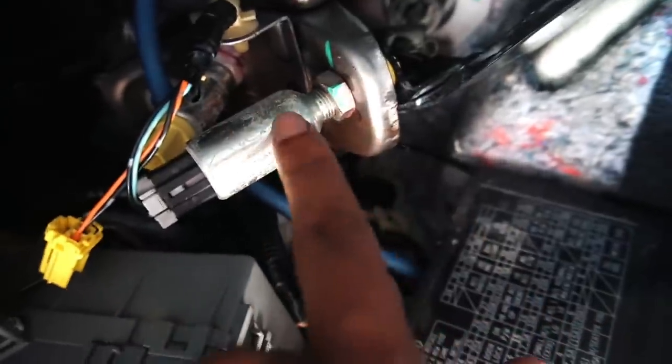Now we're going to adjust it. To adjust the pedal is mad simple. You need a 17 millimeter wrench. This is 11/16 in standard, but same stuff. It's gonna be hard to see, but basically you want to make this nut loose, counterclockwise. I think it's the one on the back. No, it's just for this one. Make this loose and then turn it counterclockwise.